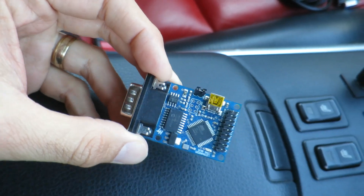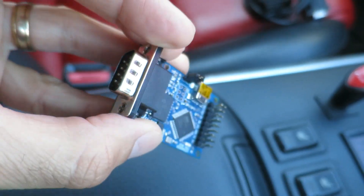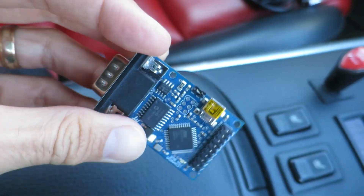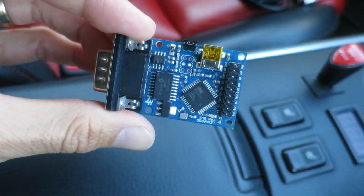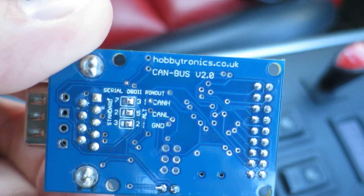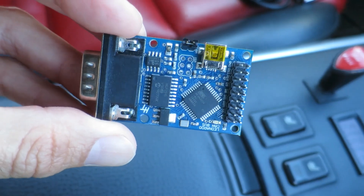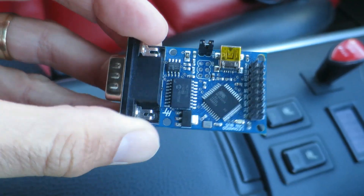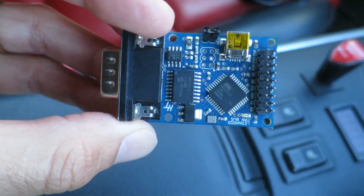To decode how the RX8 works, this little device here is an Arduino - you'll see these referenced a lot online. This isn't just an Arduino; it's actually got a CAN bus shield on it as well. That's what the nine-pin serial port is on the end. It's got the Arduino chip and a CAN bus shield built into one. I'll put a link below to hobby electronics where this came from. These are really handy because it's an Arduino and CAN bus all-in-one.